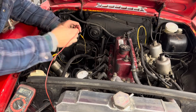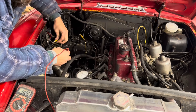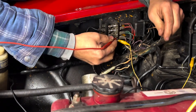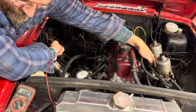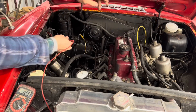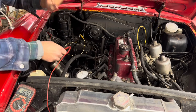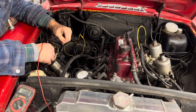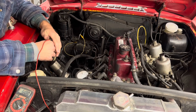All right, now we're back. I'm going to actually manually run the motor by connecting it directly to the fuse box and testing it again. When the headlights are on and using the blower motor, it's not keeping up with the system, which could explain why running around in the winter time like it is, when he tries to go start it in the morning it doesn't have enough juice in it.